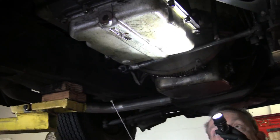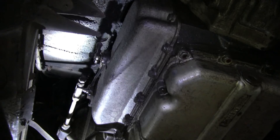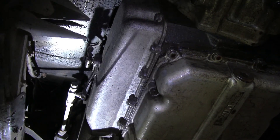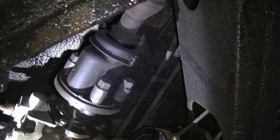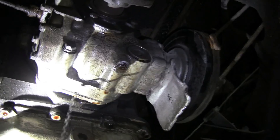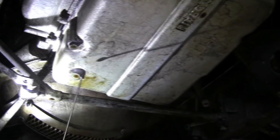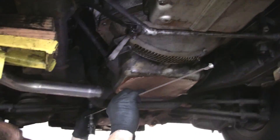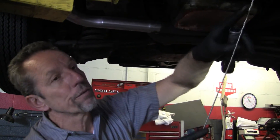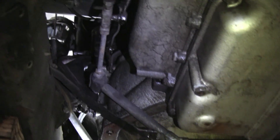On the transmission, common leak spots are around the pan gasket. Up here you have the gear shift selector linkage plus the throttle linkage — a lot of times there's a seal and an O-ring in there that'll leak. The side cover can leak, and the tail housing unit is where the rear seal leak is. When they leak out of there, you've got to pull that big unit off, which has a lot of gears and things in it. Another place it can leak is the front of the transmission. A leak at the front of the engine can come all the way back to this point and drip down because it follows the block.